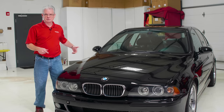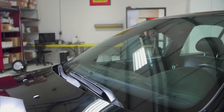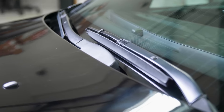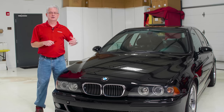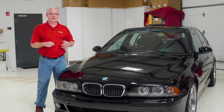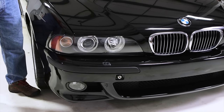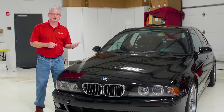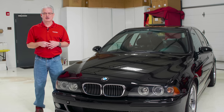I'm also going to be looking at all the edges — I know there's compound, and when you lift up the hood you're going to have to clean all that stuff out from the adjacent panels. We'll probably remove the windshield washer so we can get up close to the edges. As I look at the windshield wipers, I notice the plastic is all faded out — we've got some trim restoration to do there, not just throwing some dressing on it, but an actual restoration product that's going to turn it back to black and stay that way for a long period of time. Around the bumper, since I know it's been off and repainted, I want to take a look at all the trim to make sure everything fits tight so we don't run into problems when we're doing polishing.